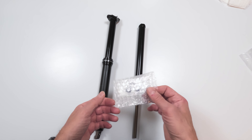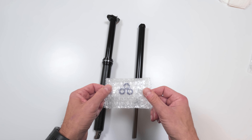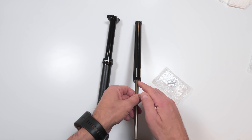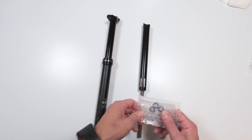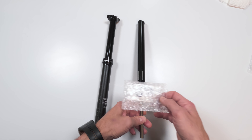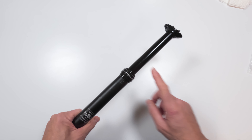The one that killed me was this one over here — it had to come from Asia. This other one came from the O-ring store here in the United States. It took quite a while; I had to buy it on AliExpress. This is probably the one that's actually leaking because it is leaking from the bottom, and this is the U-seal that goes on the bottom. I had to wait about six weeks or more for it to arrive. That will be a separate video — this video, you will be fully servicing this dropper and replacing the damper.